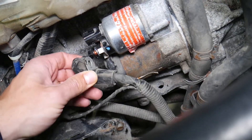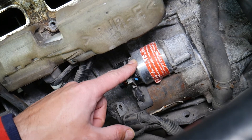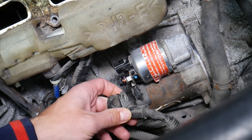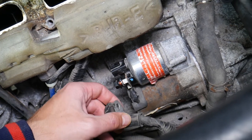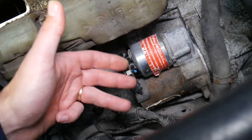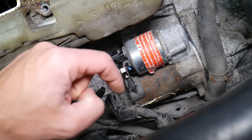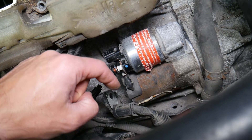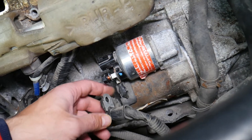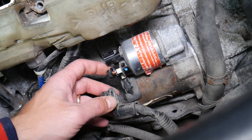The starter has two wires — one is the 12-volt wire coming from the car battery. Every time you remove the starter or work near it, you need to disconnect your car battery first. If you touch that positive wire to a ground wire, you'll see sparks, and you can burn the engine computer and electronics, which is expensive. On modern cars, it also matters which battery terminal you disconnect first and reconnect first.